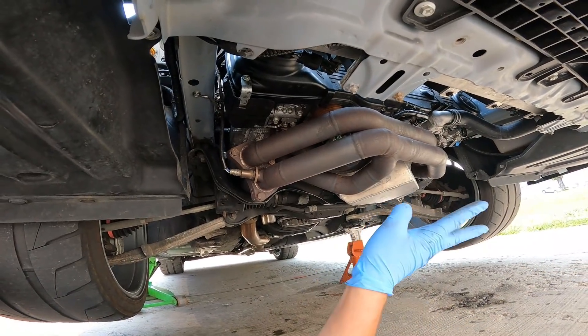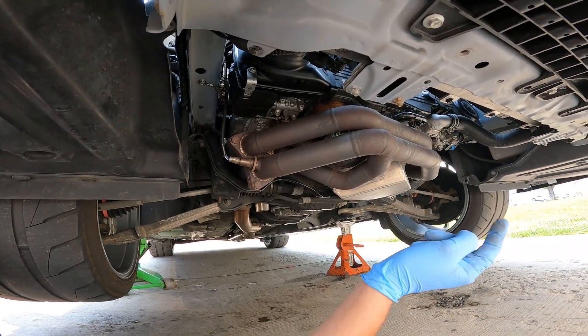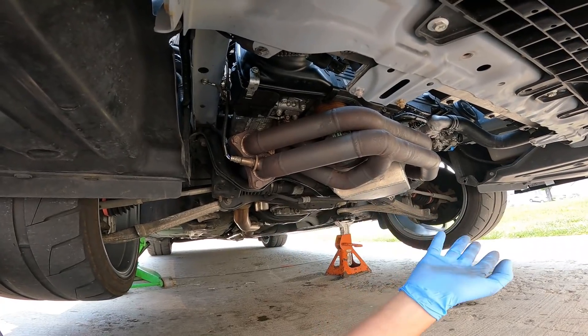We have our normal six bolts on the head, so I'll grab my ratchet and get that pulled off. I'll show you further on the crack once it's off. Also, I listened to you guys - I ordered a 0.82 exhaust housing, actually it's 0.85 or 0.86 for the twin scroll, to get rid of this 1.15 really big exhaust housing. That would be great if we were going for 800 wheel or the moon, but this thing is just too big for this car.